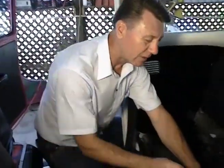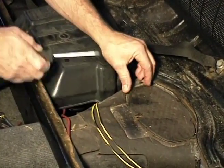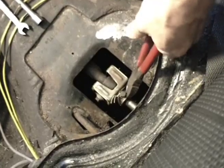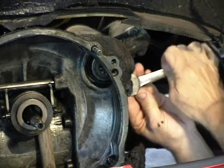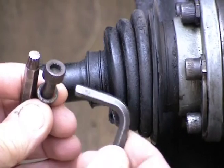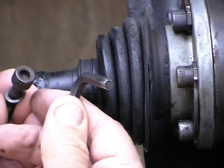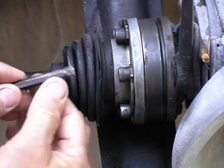On the car, we've got the back seat out. We want to take the screw out of this little inspection plate — this one was a Phillips, but usually it should be a straight screw. Right here is where the VIN number is on your chassis as well. Then we take the little plate off, and right down here is our coupler. We start by clipping the wire off this safety wire and pulling it out. You can take the battery cable and solenoid wire off and leave the starter on, but I'd rather take it off. Be sure to unhook one of your battery cables. Some earlier ones have a hex head inside — use only a 6-millimeter Allen wrench if you have an Allen head in the socket, not a hex socket, or you'll ruin it. Clean these out well on the inside so it fits in deep. That way you won't strip it before you even get started.